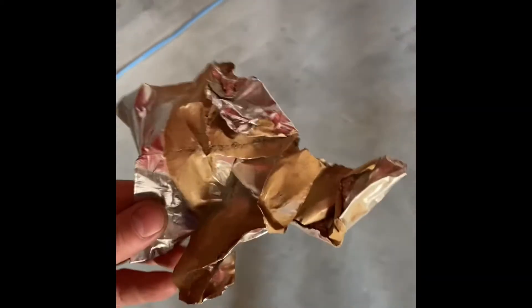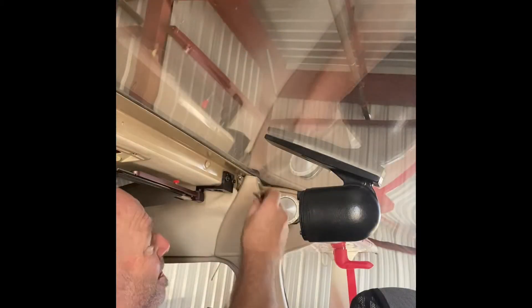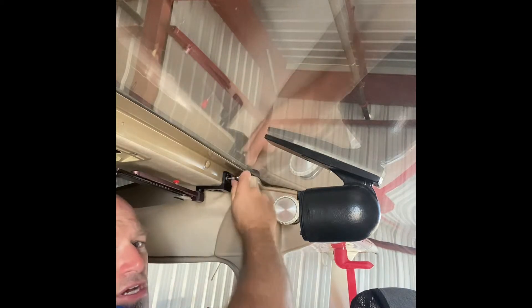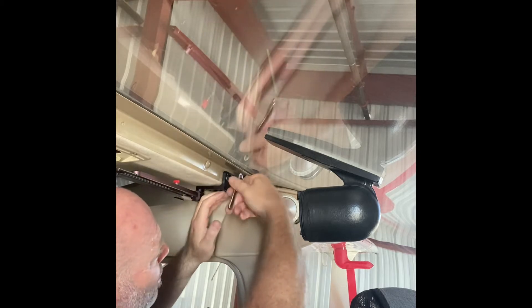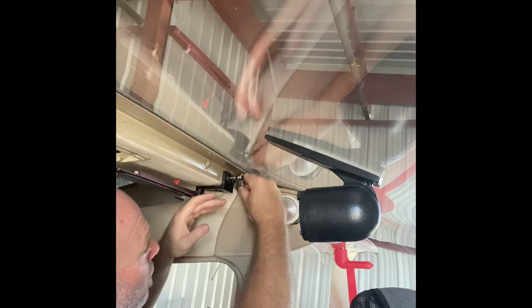There's not a lot of room between the fuselage and the wing, so really the only way to access up inside of there is through the cabin — that's why I'm pulling the headliners out of the way. I'll be able to get to that hole right there, which for some reason was covered in some really gross aluminum tape. Pulled that off. I can see the reason why somebody wanted to cover that up, but I don't think they did a very good job. I think I could do a better job putting it back together. I've also got to get up here and remove the sun shades and sun visors and then the strip across the front of the headliner. Once that's out of the way, I'll be able to take this trim piece off and have better access to peel the front half of the headliner off.